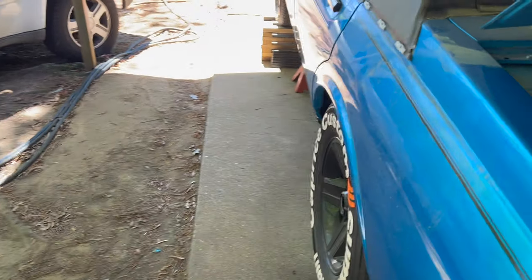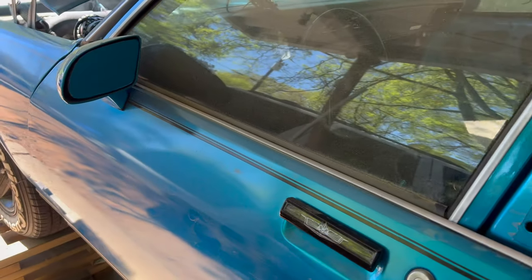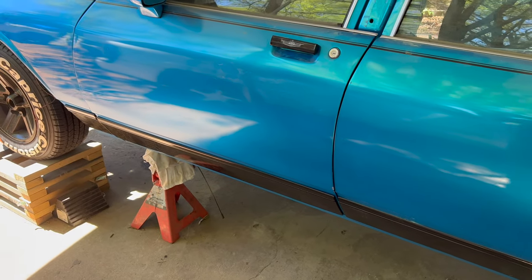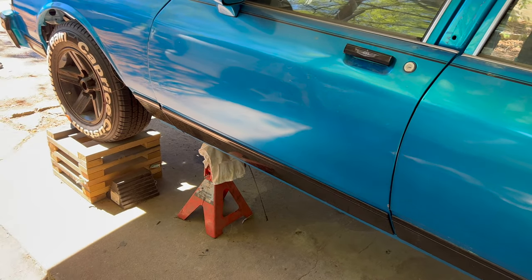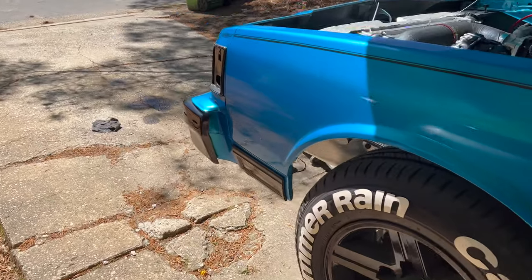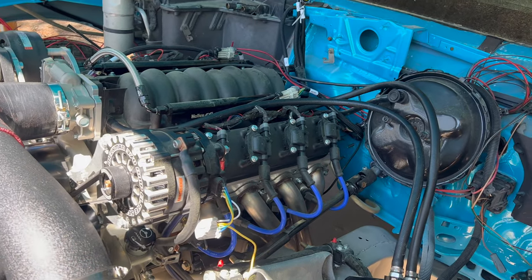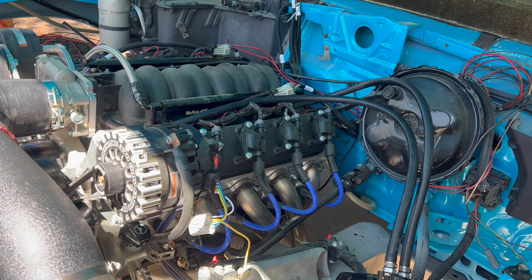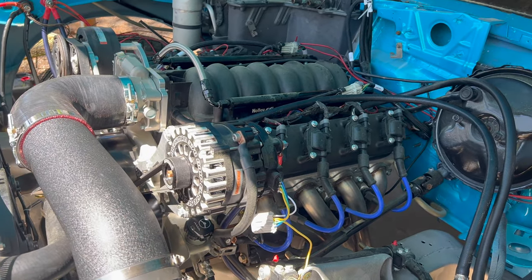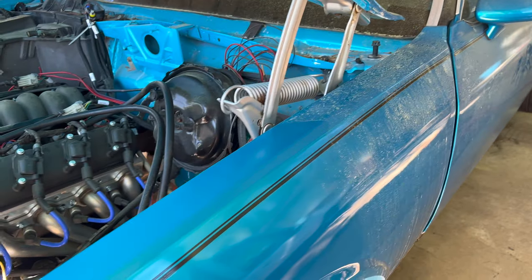But right now, this baby is not firing up. And I honestly feel like if the voltage ain't dropping down so low, I feel like it'll turn that starter good enough to be able to fire this baby up. Might be wrong, maybe not. But it's drawing a lot of voltage as I'm trying to start it. It's dropping it down low. I don't know if I got something wired up wrong or what, but everything on the handheld looks good.